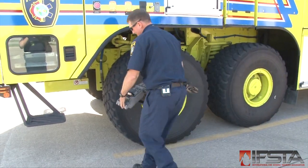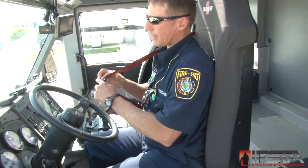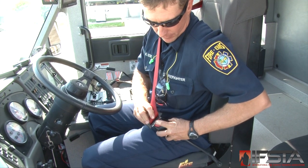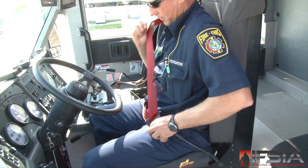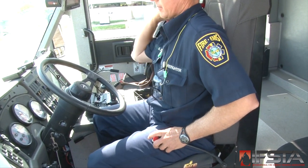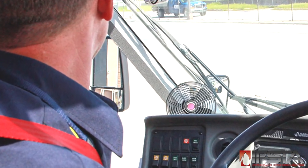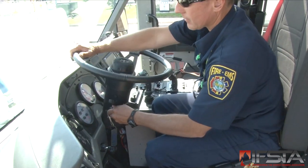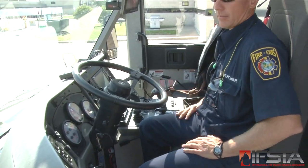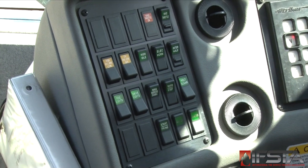Chock the vehicle's wheels and mount the vehicle cab safely. Check the seatbelts and restraints — be sure that they are securely mounted and operate freely without binding. Make certain that the webbing is not damaged, cut, or frayed, and check that the buckles open and close freely. Check that the mirrors are not missing or broken. Make sure that the tilt/telescopic steering wheel is in a suitable position and functioning correctly. Adjust the seat and mirrors, then turn off all accessory electrical switches.